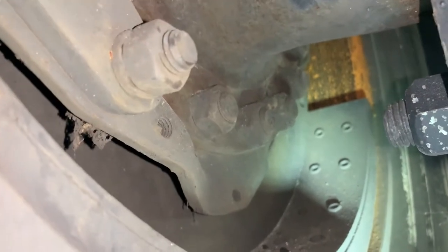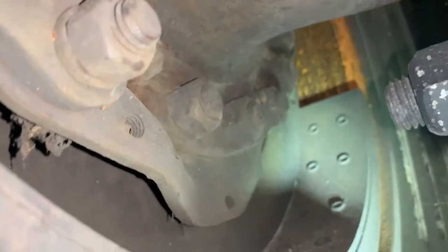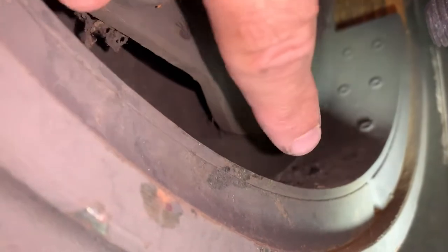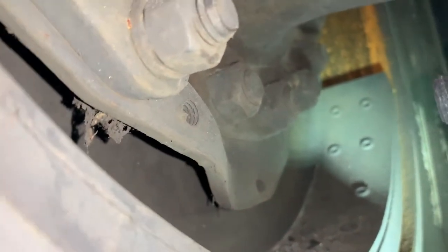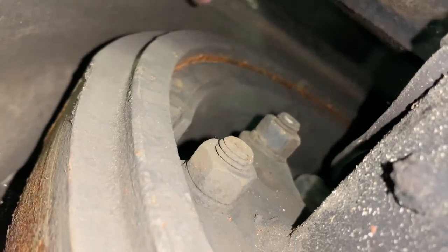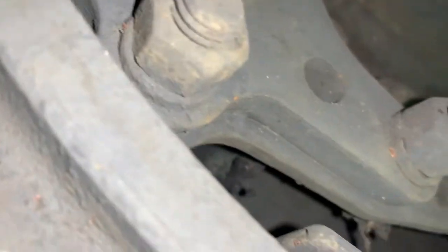I'm underneath the coach now at the back wheels. The parking brake only is on the drivetrain — not at the front wheels, just on the back drum. What you can see is after I drove it in the wet, put it through salt and all that, this area here is pretty rusted. Here's the drum, here's the brake pad, and the parking brake compresses it against the drum — that's what keeps it from moving. It was not releasing; it was sticking and not allowing me to go forward or backward. I tried rocking it a bit, but didn't want to force it and break something in the braking system. You can see more rust up in here all along there. Here's the shoe that goes on the inside — this is fairly open to all the elements, so it's going to get wet and get rust in it.